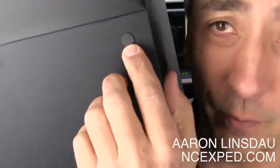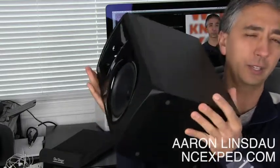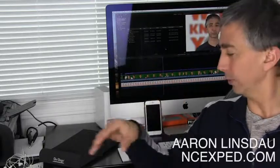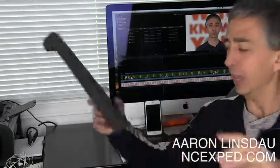On the bottom of the speaker are these tiny little rubber feet, which puts your speaker exactly one or two millimeters above the surface of your desk. So even though the speaker is isolated from your desk theoretically, acoustically it really is not. These rubber feet are here really for symbolism. These speakers — whether it's JBLs, Yamahas, Adams, or whoever else — they actually expect you to purchase these foam blocks.